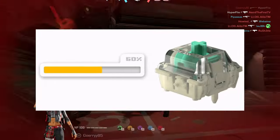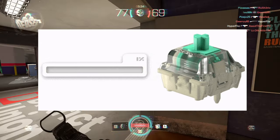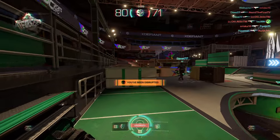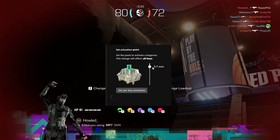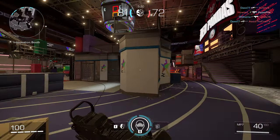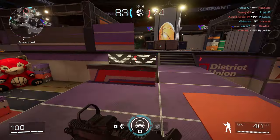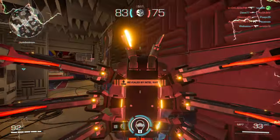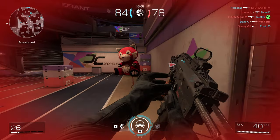Well, they have a small magnet inside the switch which can measure the distance between it and the bottom of the switch. Because it can measure this, it allows you to set a custom activation point. So, for example, if you want the switch to activate only if you press all the way down, you can do so. Or if you want it to activate as quickly as possible, then you can set it to something like 0.1 mm, so that there is virtually no travel when you press a key before it is registered as an input. This switch technology is the core of our Wooting keyboard and is one of the main reasons why I think it really is the best keyboard you can get for gaming, but I will dive deeper into the performance chapter. For now, let's remain on the feeling.